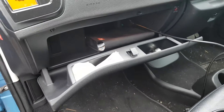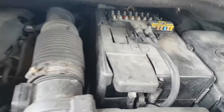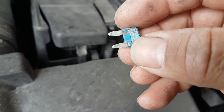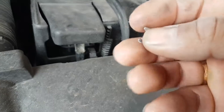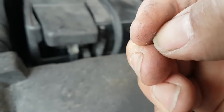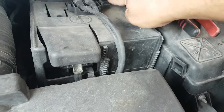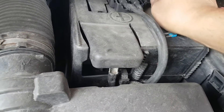Let's start with the basics — check fuses. There are two fuses apparently for the box: one is this one here for the OBD port. Look at the state of this fuse — look at the inside, full of corrosion. And the inside of the fuse, although it looks okay, it's full of corrosion as well. I'm wondering how those pins are going to be in there where the blade goes. Let me replace the fuse and see what happens.